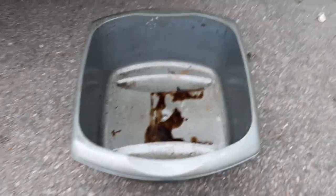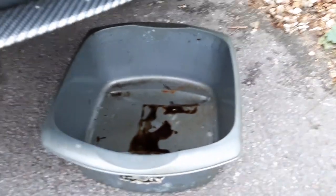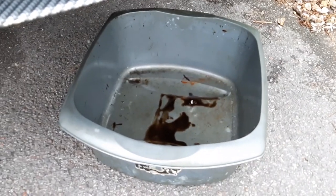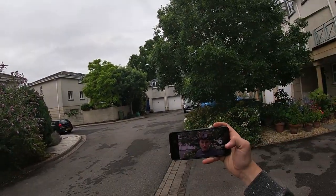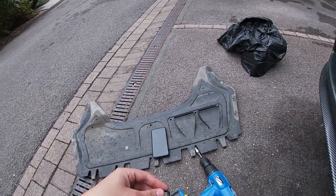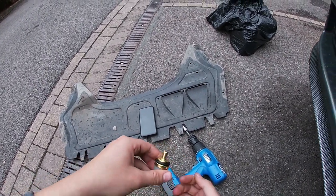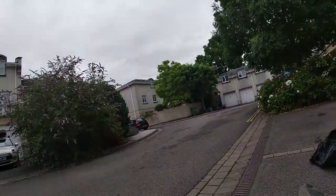This is part of my oil kit — literally just an old washing up bowl because it was cheaper than buying a drain pan. I'm going to use this to try and catch any coolant drops or spurting as I change over the sensor, because as soon as I take the old one out coolant will start leaking. I've got a new ring and new sensor — put the ring on in the appropriate place and here comes the fun part.